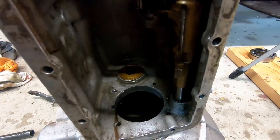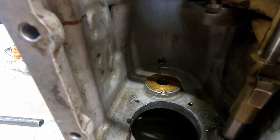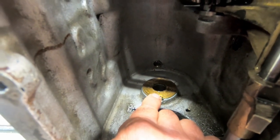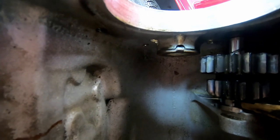One important thing before we begin: there are two thrust washers that go around the countershaft. There's a large one that goes on the fore end of the gearbox, and there's also one on the aft end. Make sure those are in there. To properly check the end float, we need those two in there before we put the countershaft assembly in. We're going to give this a try.